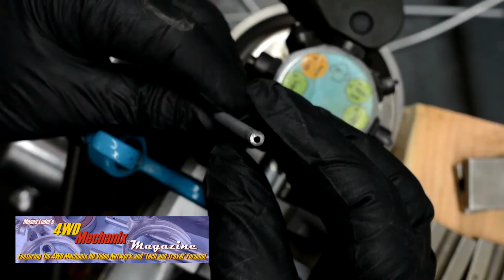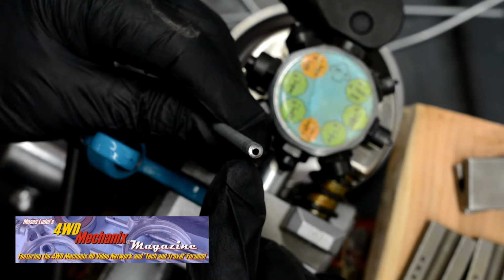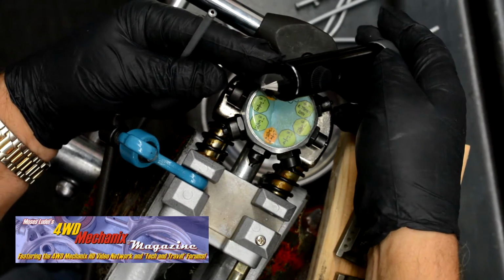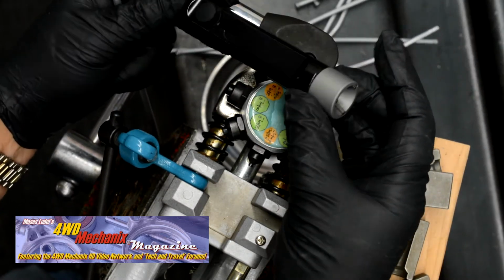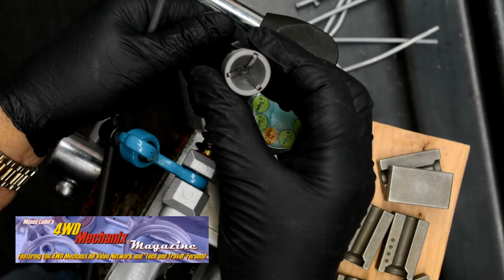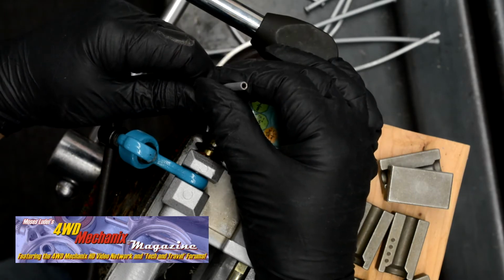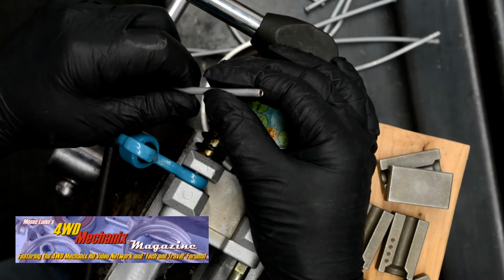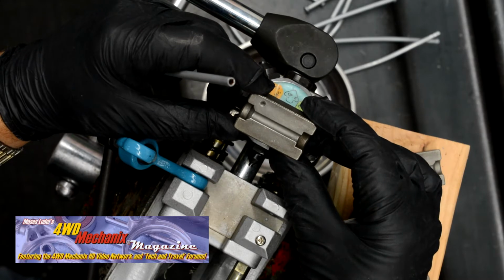The cut tubing end requires deburring to restore the inside diameter and set a chamfer at the outside. The standard SAE tubing is 3/16 inch with 28 thousandths wall thickness. The inline tube tool shown here is for deburring with 45-degree angles at the inside and outside of the brake tubing. With the inside diameter restored and a 45-degree chamfer at the outer edge, the flare end will form easily.